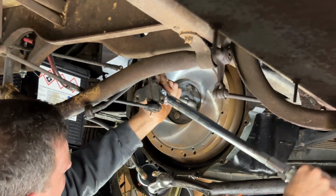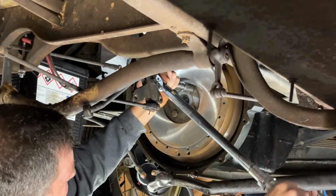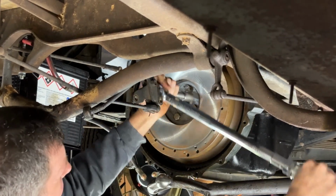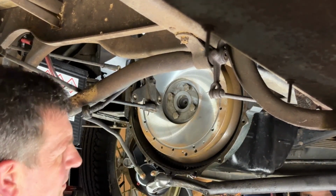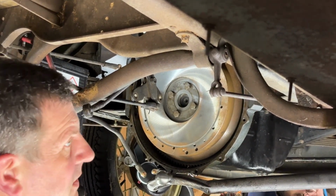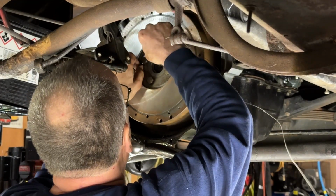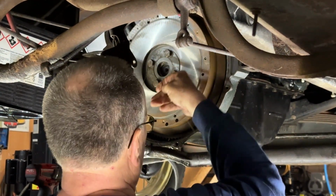We're torquing these guys to 65 foot-pounds. Do you have a transmission shaft to put in there? There's a deposit or something if we return your own part. So there we go. Got him? Now we need the safety wire. I'm gonna bring my wire, it's a little heavier than that, it doesn't need to be. This is 32. Should be 32.